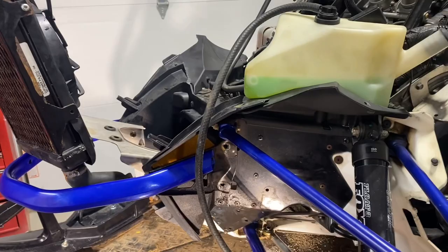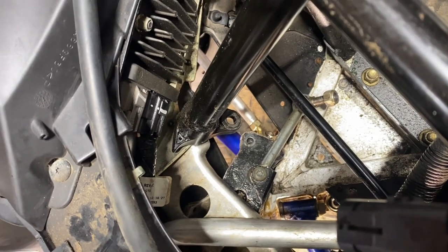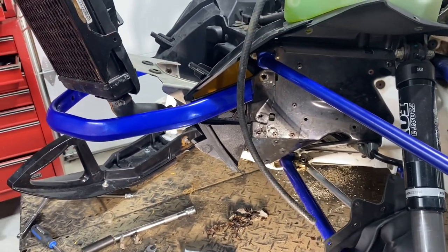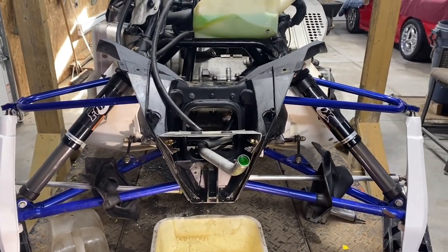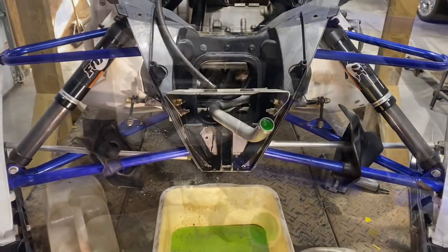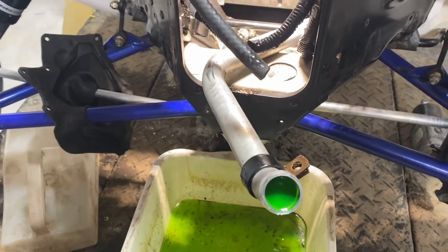This job just keeps growing. I've got to get the front end apart to remove that aluminum pivot piece — I can't lift it out as-is. I'm taking off the bumper and the plastic shroud to see what that exposes. I got the rad out and now I need to pull the plastic shroud — two torx head bolts on it and two more up top. There was one bolt that went in at the bottom of the cover that was rusted, but a little WD-40 and working it back and forth eventually got it out.